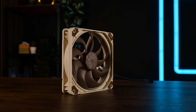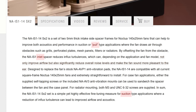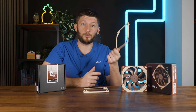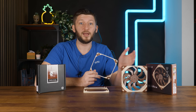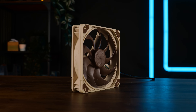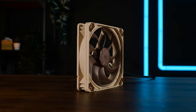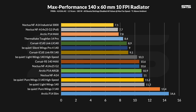Now let's talk about something that can be benchmarked. Throughout the whole page, Noctua repeatedly states that these spacers are used for pull applications. As our usual radiator fan testing machine uses push applications, that was an issue. So we re-benchmarked the non-modified A14X25 as a pull fan and added it to the list. As a reminder, we benchmark all our fans on a 60mm thick, 140mm Alpha Cool Monster radiator, measuring water temperature above ambient, lowering fan speed, and measuring noise and temperature across the run to create a noise-to-performance curve. And the NF-A14X25 is a much, much better pull than push fan — ridiculously better.